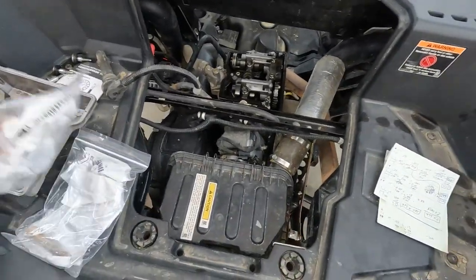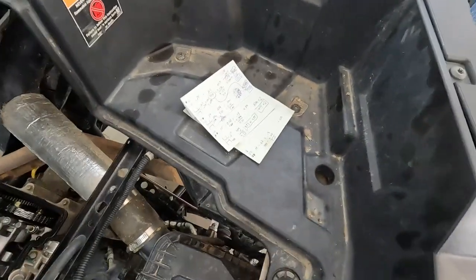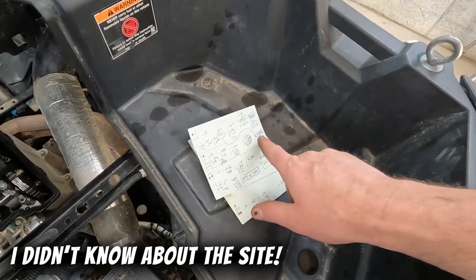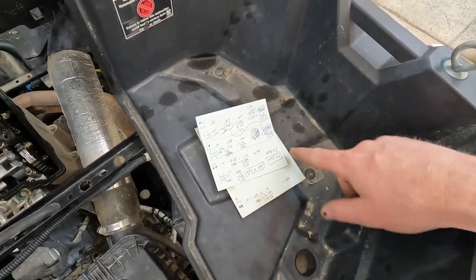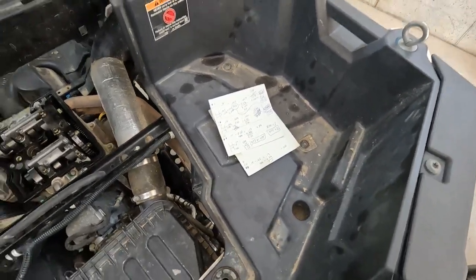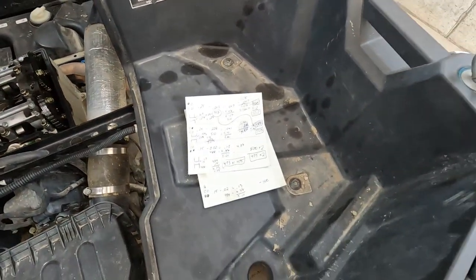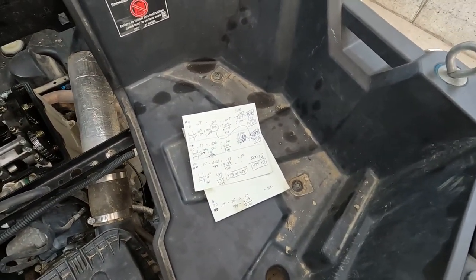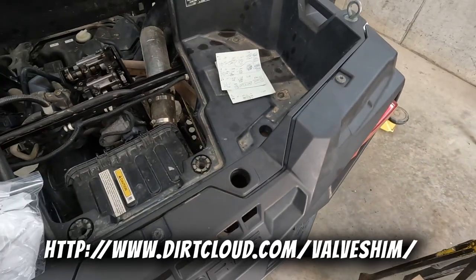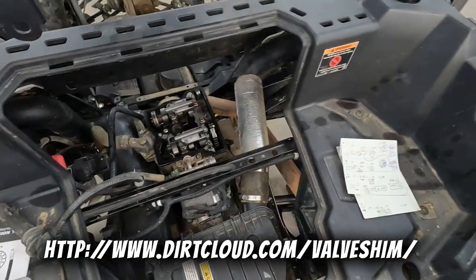I got some tappets here and I got my math. I had to do it twice because I did it wrong the first time, but I figured it all out. We're going to reuse a 508 there, and you've got a 502 — or sorry, two 475s — and that should get us pretty darn close. I did the math by hand, and then just out of curiosity I did a web search and found that there are shim calculators available online. You just type in your measurements and it tells you what you need. So that was helpful.